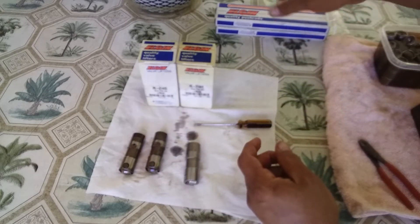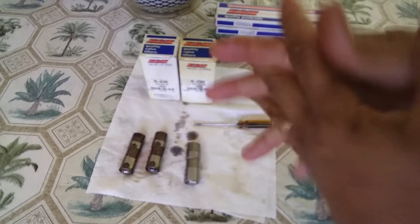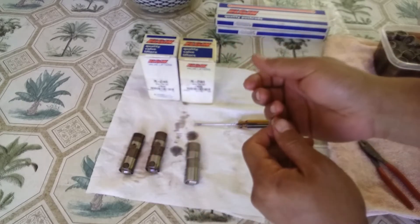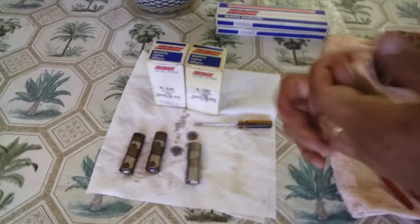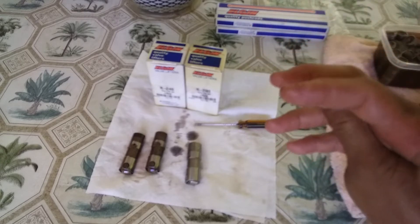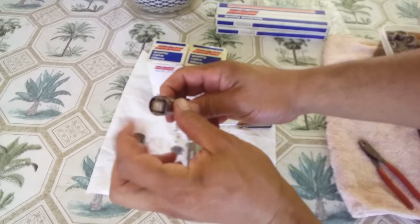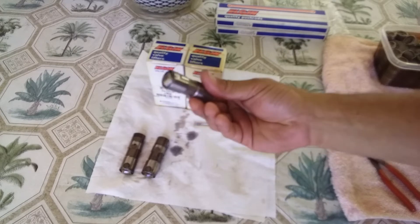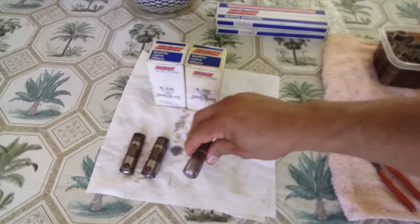The heads are coming sometime next week or the week after. They're from a local shop in Tampa, Florida — they sell through eBay so they might get here within the week. That's what I'm recommending and what I'm gonna install in my 5.3 2000 Silverado with 127,000 original miles. These lifters have 127,000 miles on them so I'm just going with new.